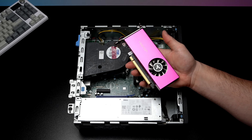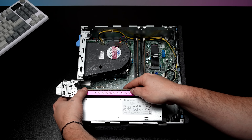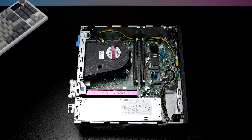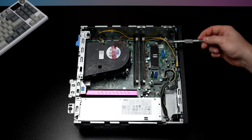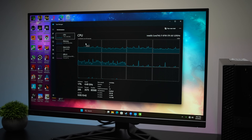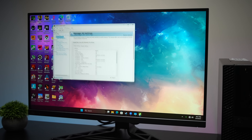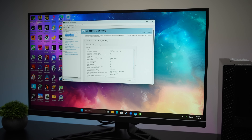The last thing we need to do is install our low profile single slot RTX 3050, which has 6 gigs of GDDR6. I personally like the RX 6400 but with only 4 gigs of VRAM some games struggle with it, so that's why I opted for the RTX 3050. We've got everything installed and it's time to boot up. From NVIDIA's control panel I usually set this to maximum performance — out of the box it's set to normal but we want as much as possible. You can also do some overclocking from Afterburner if you wanted to — 150 MHz on the core wouldn't hurt it at all.